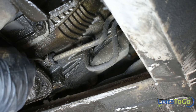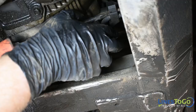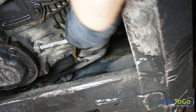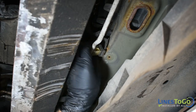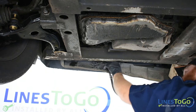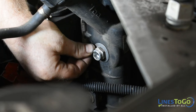Remove both plastic covers and clips at the transmission. Remove the plastic bracket and disconnect both transmission lines from the transmission fittings. Install the four retaining clips back into the connections, making sure they are fully seated.